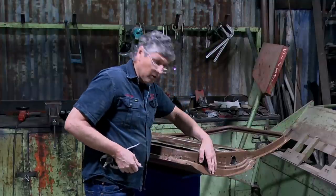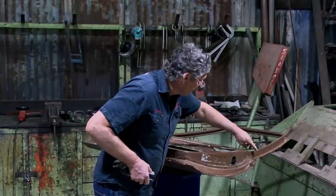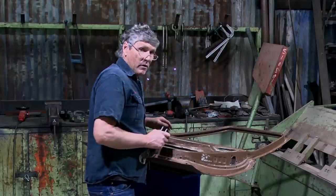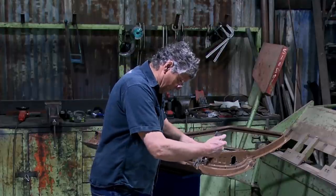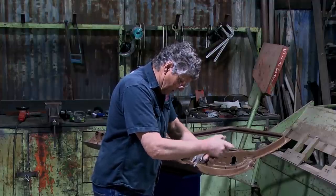I'm looking at this and coming along — there's rust in this seam all the way up. It's got some evidence of rust right up the top here in the frame. We're going to have to do that, but we might get this skin repaired and welded on, and then we might take the whole thing off anyway — that'll be something else we can talk about as we go. For now we just want this skin off the panel so I'll grab a grinder and we'll rip around it and get rid of it.